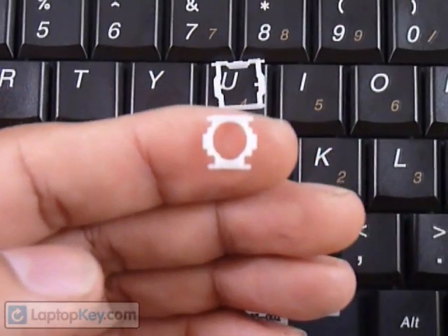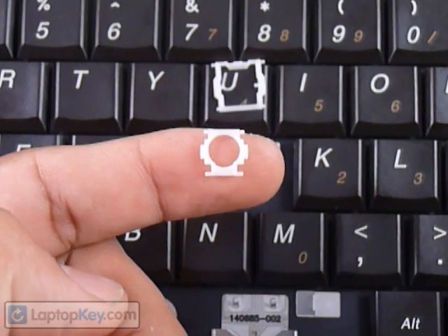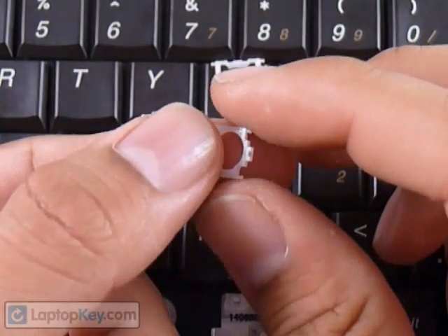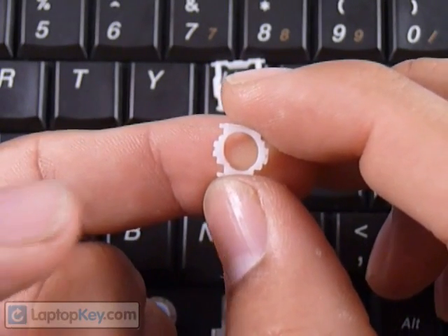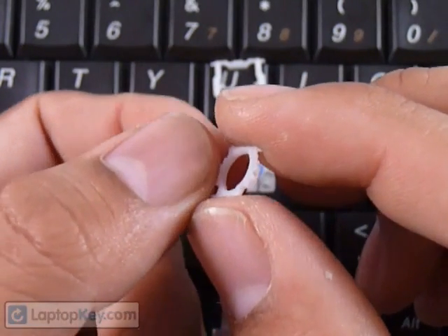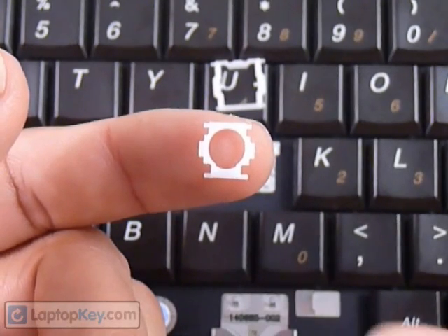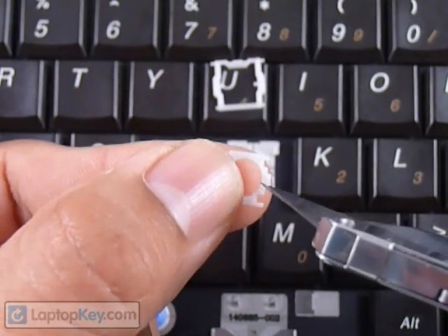Now for the small piece: it has small pins at the top and large ones at the bottom. Make sure not to put it upside down either. By looking at the middle, if you can see the fittings — holes in the middle, left and right — then that part faces the keyboard. You're supposed to see those holes on the other side when it's oriented correctly.